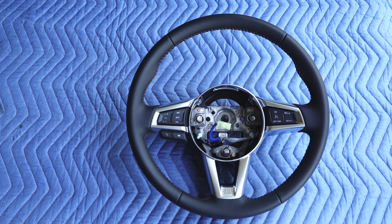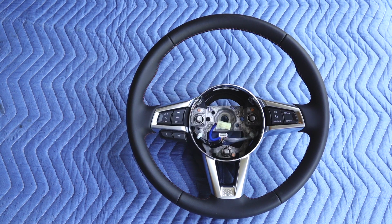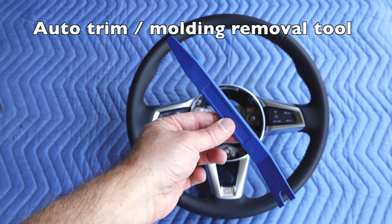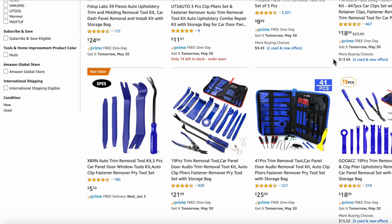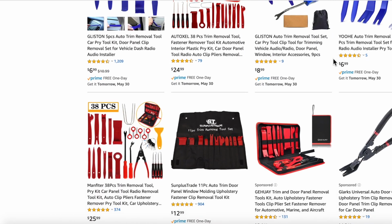All of these are attached with various clips and pins, which for the most part are delicate, and I would very much caution you to take your time when you're removing each piece. Don't rush this. Apply uniform pressure throughout. If you are using a screwdriver or any other tool to pry these off, it might be a good idea to wrap the tip of that tool in something a little softer so that you don't scratch up the trim pieces itself. For me, I do have a tool that I took out of my trim and molding removal kit. So I have a whole kit with various tools of various sizes, and I can leave a link in the description below. I also have my small flathead screwdriver that I'll use too.